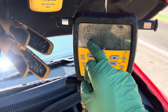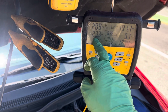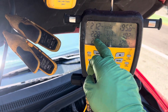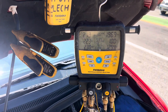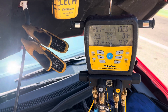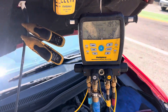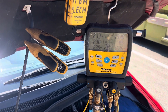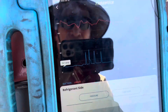We have really stabilized now. When I was 100 grams short and it was running like this, we were around 21 superheat just as the compressor kicked out because it couldn't stay running. We're just barely a little over that even though we put in one quarter — 425 grams total. I hear a lot of guys say the more refrigerant you put in, the higher the high side will go. But I just put in more refrigerant, brought it up to factory spec, and the high side went DOWN.